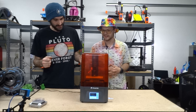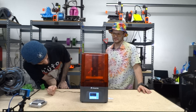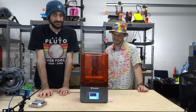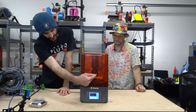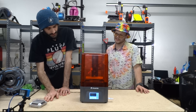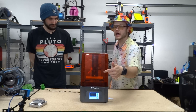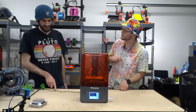Ease of setup: this printer was super easy right out of the box. You put the vat on, put the plate on — it just goes on with one simple screw. For leveling, use a piece of paper, put it underneath the build plate, loosen the two front screws and the small grub screw in the back, drop it to the home position, make sure it's snug on the paper, then click the remember button — don't forget that! The grub screws are really nice and thick; other printers I've used had smaller ones that strip out easily.